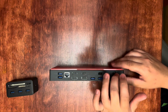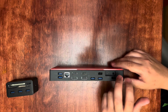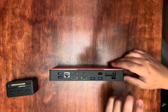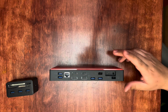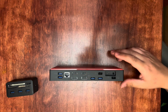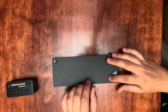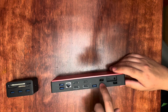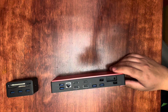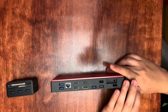since my iPad, which is the 2020, doesn't have Thunderbolt. The only iPads that have Thunderbolt are the M1 equipped iPads, but since mine has the A12Z, it uses the USB-C 10 gigabit version. So Dell also makes another one. I don't have that one, but I've seen them where they have the big USB 3.0 printer port edition of it. Again, it's in my video. And that one also does display output as well.